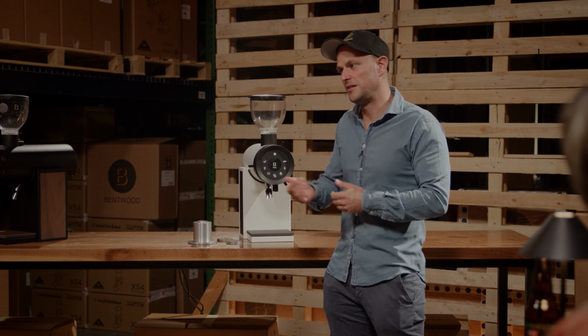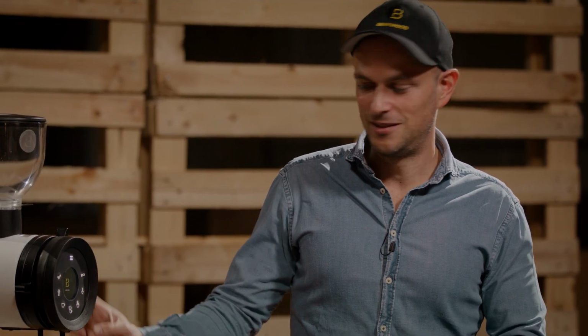So you have some busy coffee shops that say, okay, I do a single dose, I leave it on. They prepare the coffee, they walk away, come back a minute later, do another one, and they feel like they've used it only once a minute. In reality, it has been constantly on, right? And then you will start having issues. So I always recommend, finish your dose whenever it's done, and stop the grinder. And then when you put in beans again, then start it. And that's important.